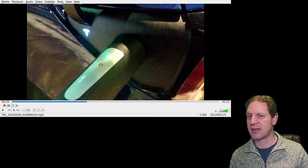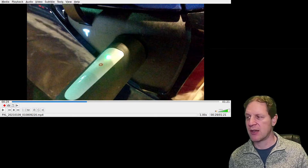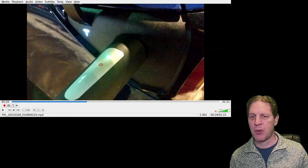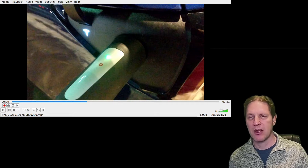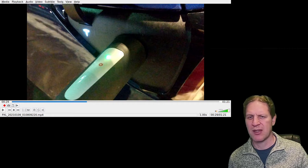You hear that click noise — push it well into that charge port, because if you don't, you're going to have problems. Once you get it in there, you'll see it flashing right away. Then after that, walk over to the BC Hydro charger or whatever your charger is, and use the RFID card. Do not do the RFID card first — that was a mistake I was making. Do it afterwards, because that first part does all the vehicle communication. So then you go authenticate, and the whole while the adapter is flashing. You authenticate and then you'll see steps like initializing, and then it's trying to start the charging process, but it still does fail. I hope that helps. I'll show video clips of both positive and negative results. I did not get to the point where it actually was charging, but I got two different errors: the first was a communication error and the other was some other charging error.